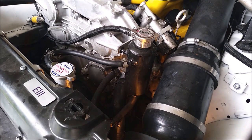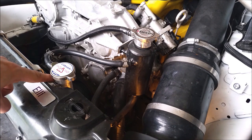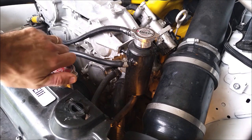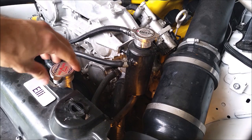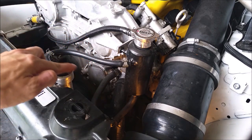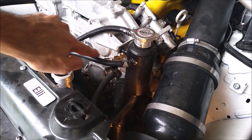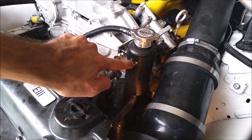The way this all works is coolant runs through your radiator just like normal and comes up to your filler neck. But instead of coming to a normal radiator cap, this is a blanking cap — it just seals the top of the radiator off and allows coolant to go through this barb here, falling all the way through this hose into the swirl pot.